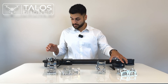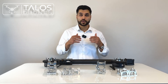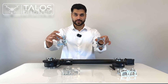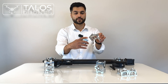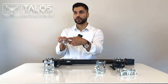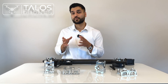In conclusion, we have two types of motors, four types of brackets, and two types of arms. The older version of arms without the sleeve is no longer available for sale, and the single-piece brackets are for those older arms. The two-piece brackets — one marked U for upper and one marked L for lower — are for the newer version of arms. When purchasing a motor or bracket, pay attention to which version you need for your repair.